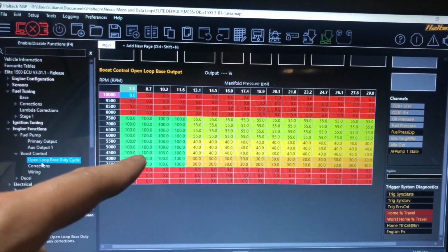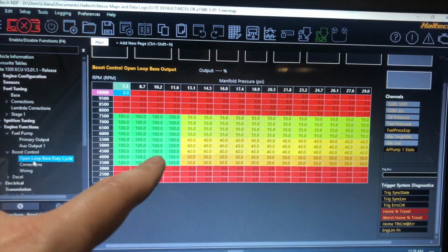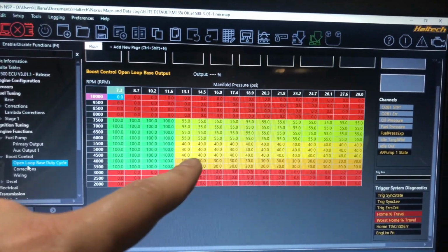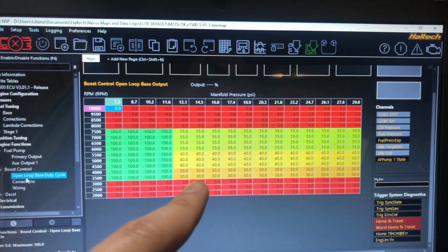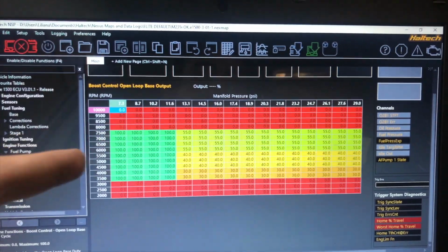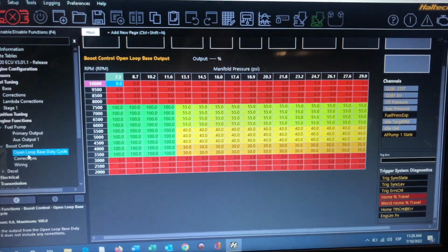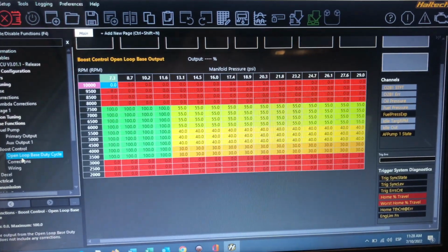So I have it on full spool up, so this is like gain on a boost controller, and then I have my boost ramping up. So I actually keep the torque down, which is what actually kills your engine. If you have too much low end torque at low RPMs, you're going to break your rods or bend them, because the inertia from moving an engine from 3000 RPMs, 700 foot-pounds of torque, is going to be a lot higher.